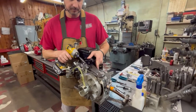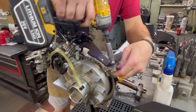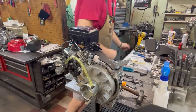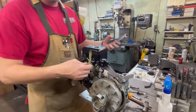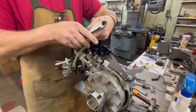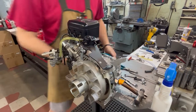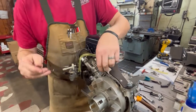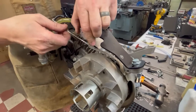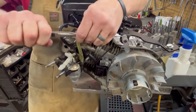So we're going to snug up the top plate here - it's the same top plate that went on the clone, many of you might have them laying around your shop. Already got the pump bolted. My stock fuel line that I used before will still work - I'm just going to shorten it up a little bit. You'll run it just like you would on a clone. I'm going to hook the throttle linkage up the same as a clone. Put the linkage to the arm - it's turned the wrong way just like they always are, so we have to bend that. What I found works best is a pair of needle nose, just lay it over.